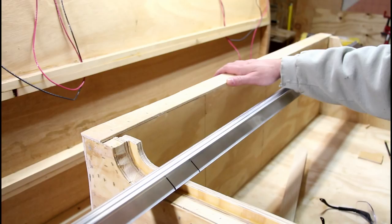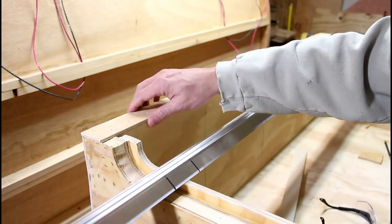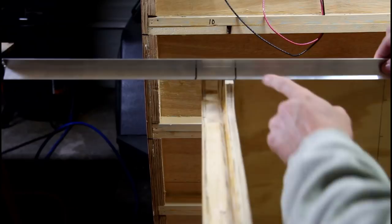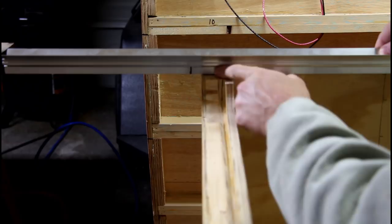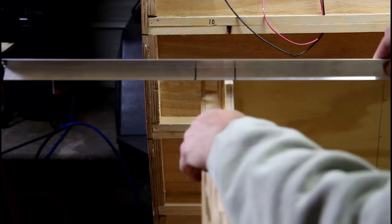I've added this piece of quarter-inch to the top here just so it matches the hatch lid, so it meets nice and flush. Right now I am marking out my hurricane hinge that I wanted to put on here. You can see the marks I've made - I need to cut this piece out and this piece out so the hinge can sit flush against this back wall. I also have about a half-inch overhang. They say on these to leave about a half to a quarter inch overhang on the sides so that when water runs out it drops down off the hinge instead of going down the side of your teardrop.